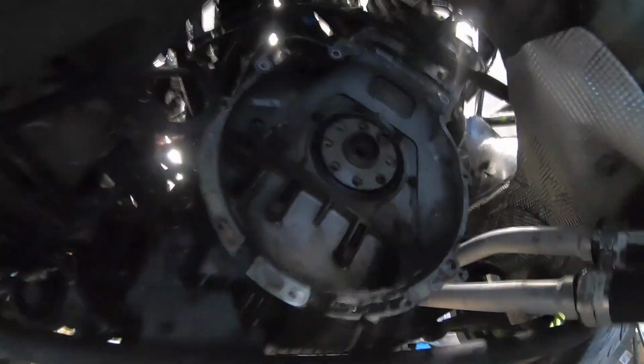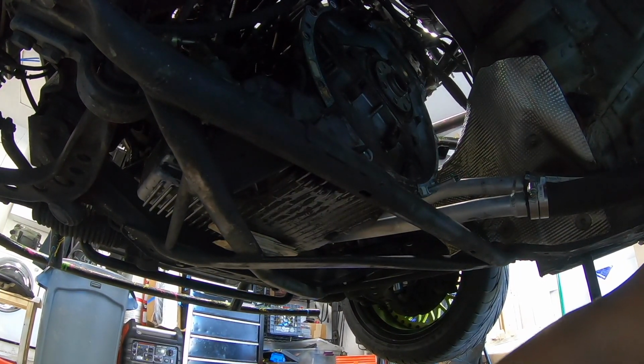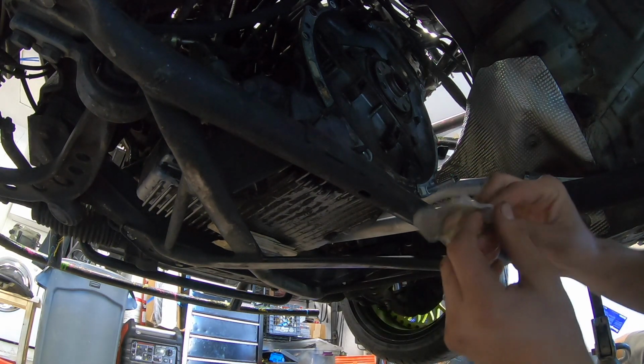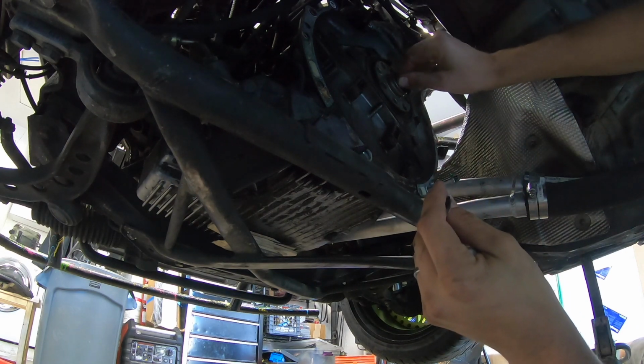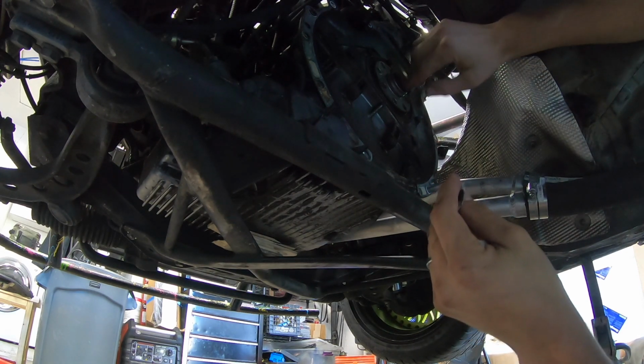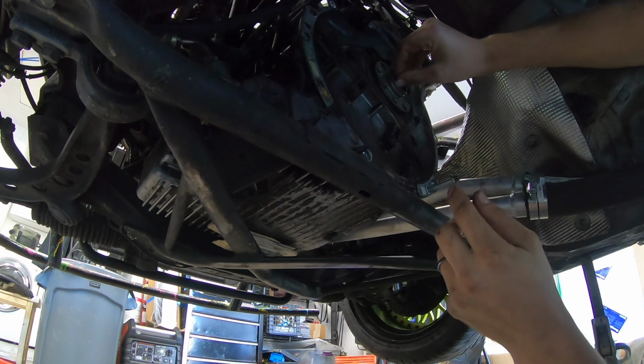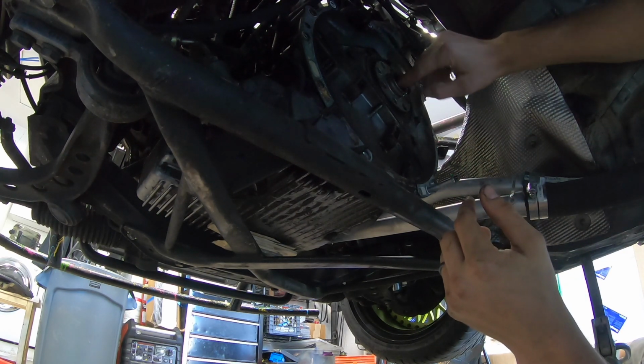Okay, guys, now we need to get this pilot bearing out, and I'm gonna show you guys an old school trick. If you haven't heard of it, it's actually a pretty cool way to do this. So what you do is take wet newspaper. Okay, so you're stuffing it inside the bearing, and what this is gonna do is go behind the bearing. Okay, so just follow me here.